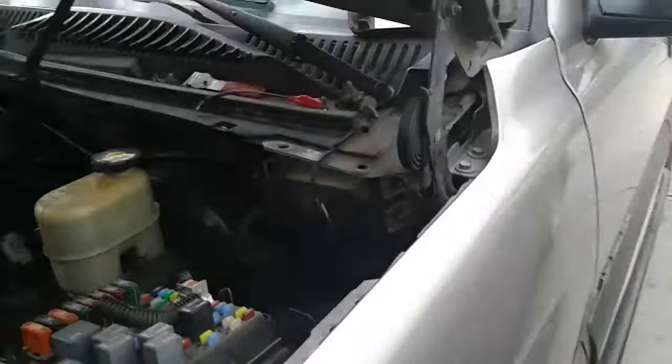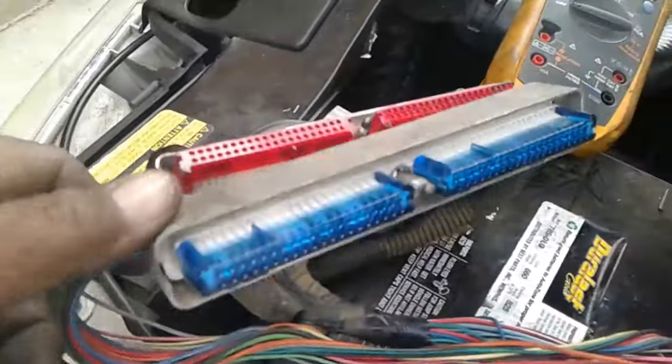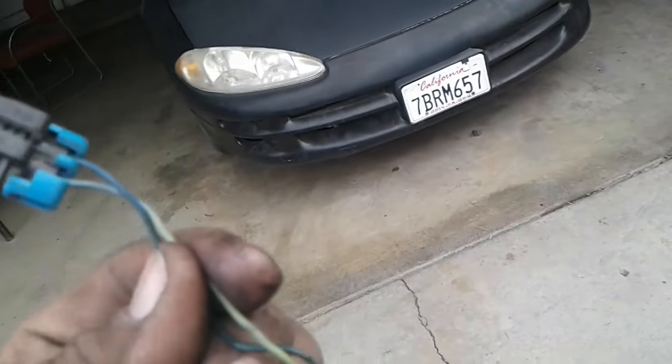Hey Hector, we pulled the plug out from right there and then I unwound all this, separated the wiring from the knock sensor to the computer. It comes here, turns that way, and here's the plug. This is the actual knock sensor wiring — that's where the knock sensor plugs in. It's light blue and dark blue, so I just followed the wire.